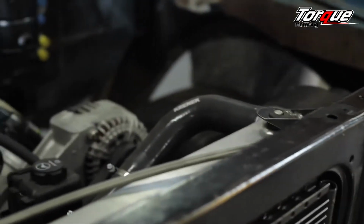Okay, so when I got you this morning, there was actually a piece of cardboard laid in here, and that's your template. That's how you template up your covers. That side's now done, and obviously you start with the cardboard and then work your way through, and then from there weld it in and off it goes, or is that going to be bolted in? Correct. Cardboard or wood, like I explained to you probably on episode 1, is the best way to get the form, and then from there we trace it onto the metalwork and start to get our shapes going.